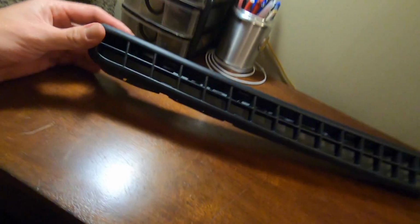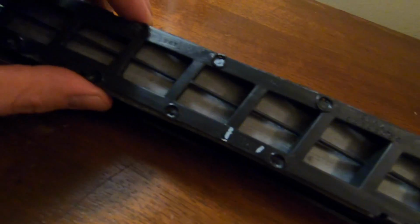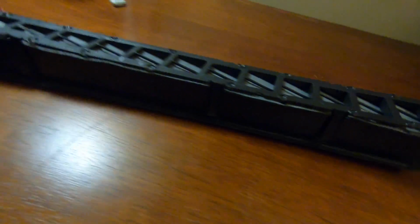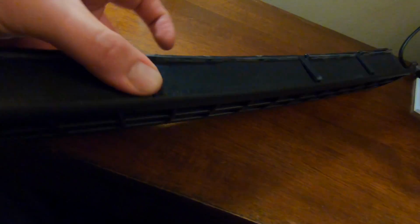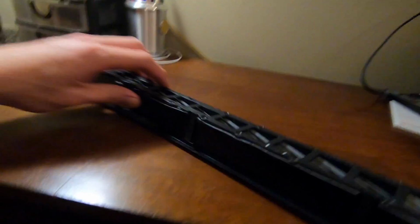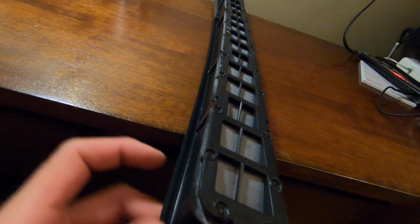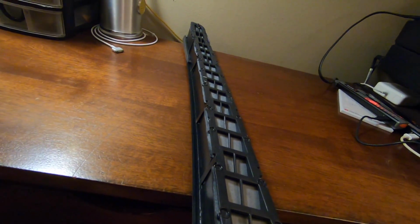and here is that vent, and for some reason it doesn't want to go in, and for some reason the plastic welds that hold it together all along here came apart, and all of these guys are loose. So what I'm gonna do is tape this to the housing so that it doesn't come apart, but more so to make it fit. If you guys can see, there is a flat spot right here along the edge. So what I'm gonna do is take off this foam that came on it, just peel it right off. I've already started on that side, and once the foam is off, I'm gonna add a 3M double-sided tape, and then I think that should hold it to the Jeep.